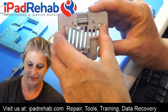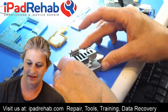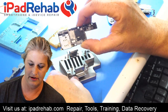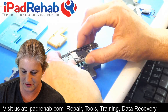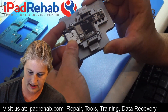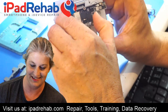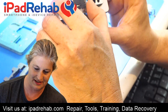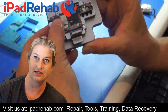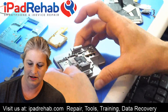So this is step one — put that base on there. Next, you're going to put your bottom board, the RF board. This is our bottom board and this is a working iPhone X, so hopefully it will still be working. We're going to kind of line it up on here. There are four little posts and it's only going to attach to two of the posts — just these two — so the other post is still just kind of hanging out.